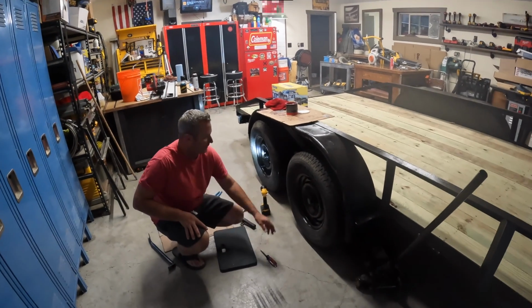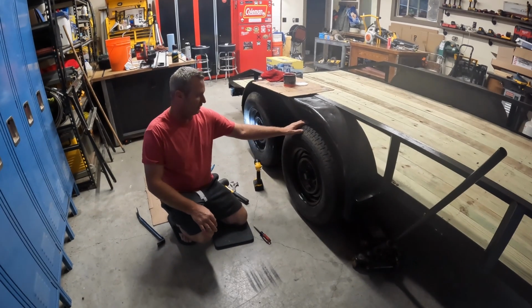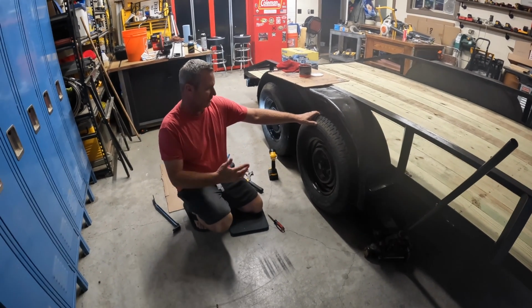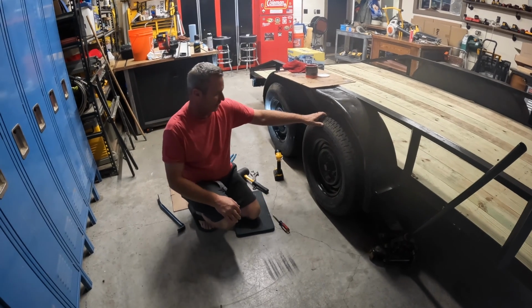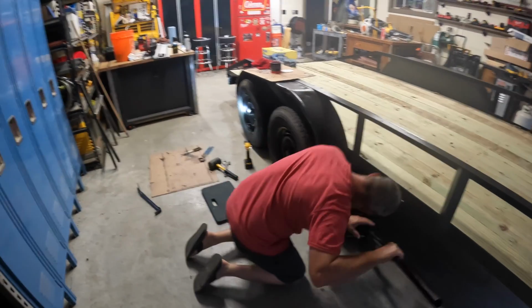I'm John. I thought I'd do a quick video. I'm packing the bearings in my utility trailer, which will involve replacing the rear seal, because it ruins the seal whenever you take the rear bearing out. I noticed there weren't that many videos on this, so I thought I'd do a quick video. It's pretty simple. Jack this up, which I'm going to do now.